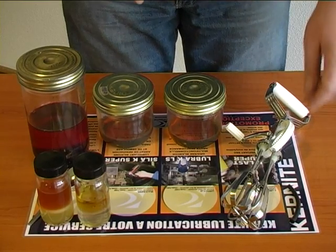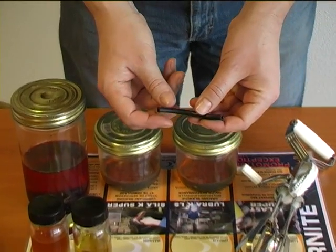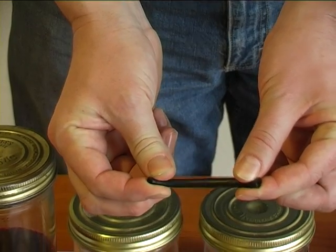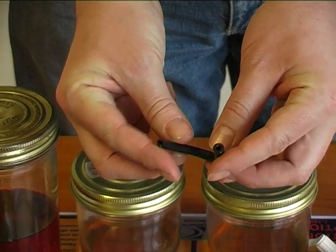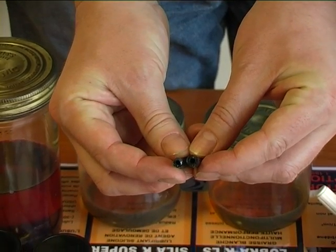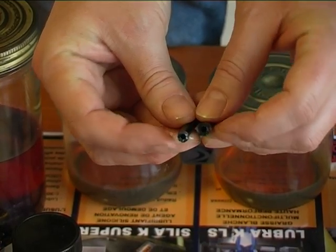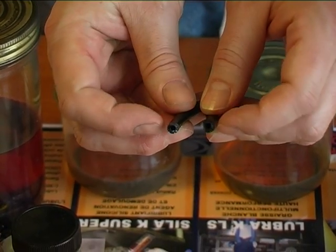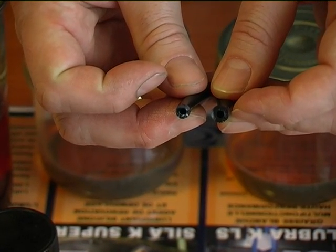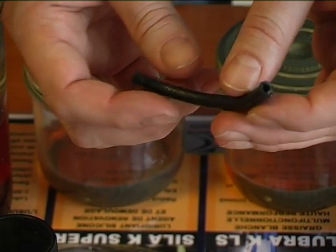In the first demonstration, take the rubber tube and show them how flexible it is. Then fold it over and compare how the seal conditioners and leak inhibitors work on the plastic. You can see one end is slightly larger than the other. This shows how we swell — and this has to be a very controlled swell, one to two percent.